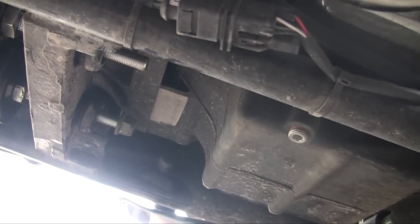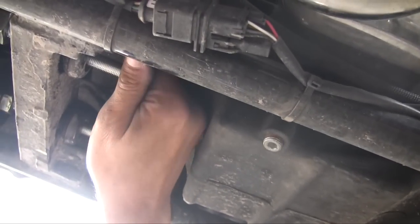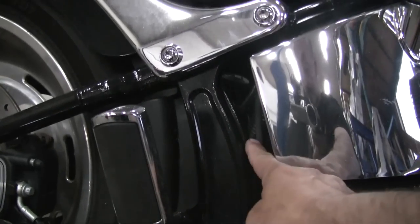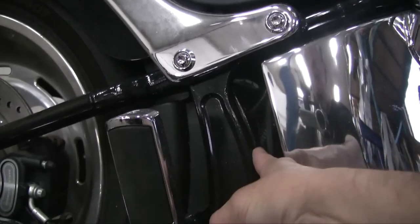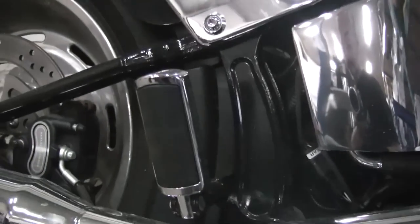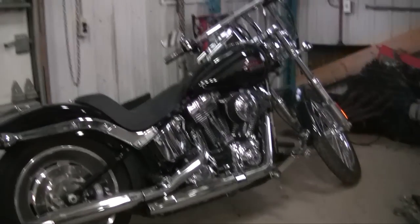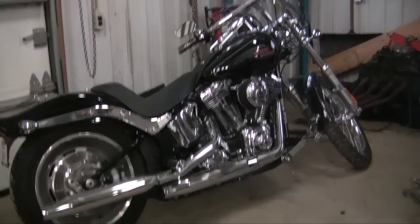For the adjustment, you're going to use the two nuts that sandwich the rubber bushing to adjust them. For the back ones, you'll need to count the turns — you want them equal length. Adjust them so that the control arm does not extend past this part of the frame. Mine extends a little further because I ride solo all the time, so I've lowered it a bit more. That's a question of choice — you can always ride it and see if it bottoms out.